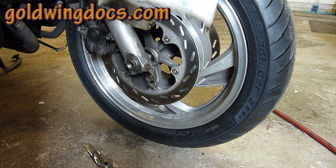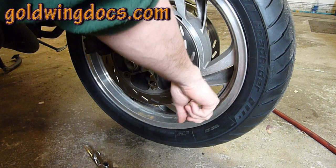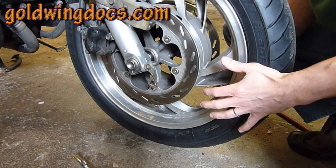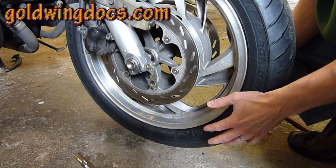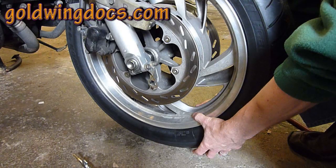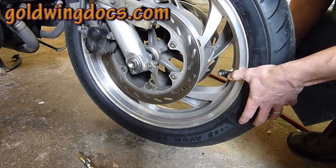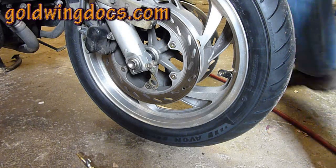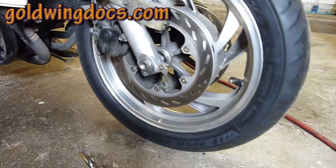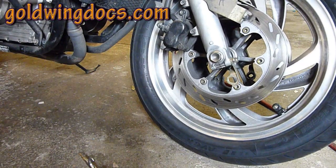The first thing we want to do is position the wheel so that the tire valve is at about three to four o'clock. This bike is on its center stand, so it's safe — the back wheel is in the air. The front wheel has maybe 30 or 40 pounds of weight resting on it, so you can rotate it. Only rotate it backwards, because rotating it forwards will pull it off the center stand and dump the bike. Pull it at the bottom and rotate it to about four o'clock, then leave it on the side stand for better access to the valve.